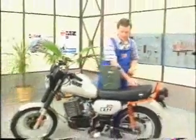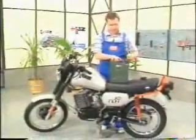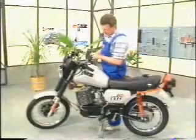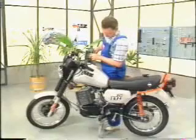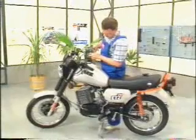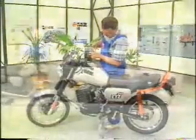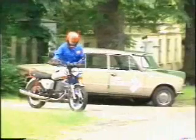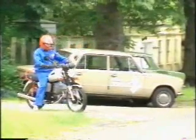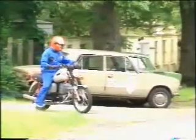Exclusively for the first test ride, use approximately 2 liters of petrol oil with a 50:1 mixing ratio. Normally the engine runs on petrol only. Carry out an approximately 5-kilometer test drive. Apply the brake systems to check for correct function.